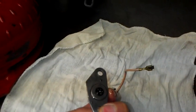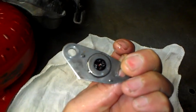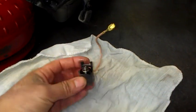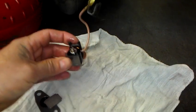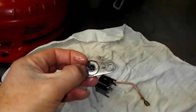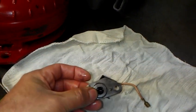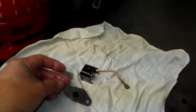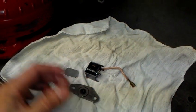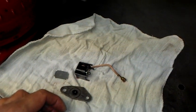It's actually a solenoid. You can see there where it just got detached — this was actually hanging in there. There's your pass-through connector on the case for the kick down switch, and this is the kick down switch itself. The ball got lost. It has a little check ball that seals — goes here — and it's normally closed.